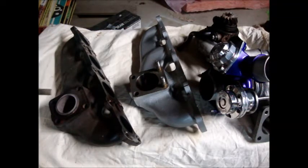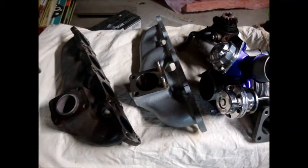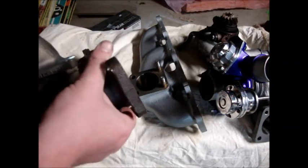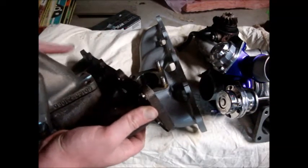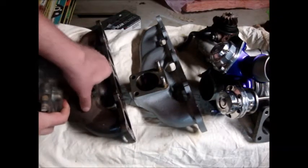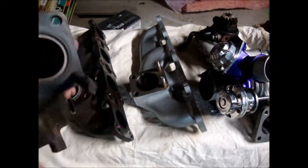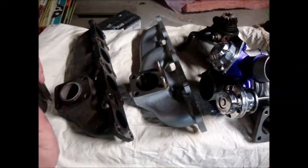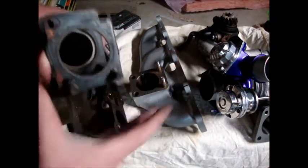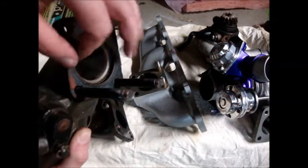What we're talking about in regards to this is this flange — you can see here it's perfectly shaped, and it's basically there to make these two surfaces sit as close as possible when bolted together. That's not really needed; we've been turbocharging vehicles without that wasteful chunk of metal for quite a while. Here's your gasket — that's how much it's supposed to flow. If I slide the gasket — it's warped — you can see that's how much flow we're missing. That's quite a bit.